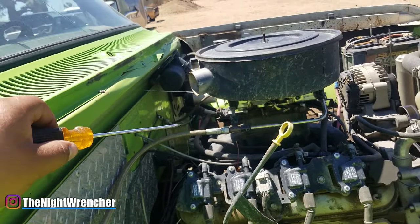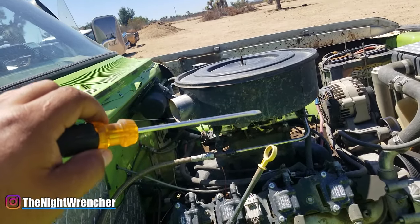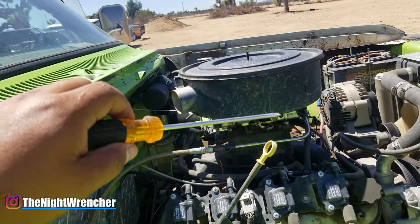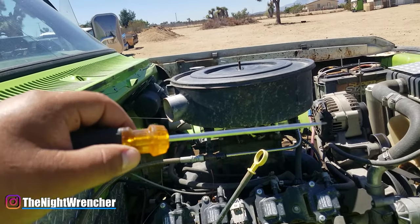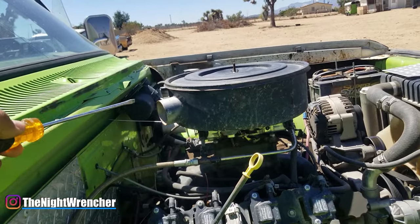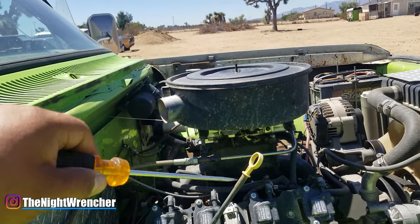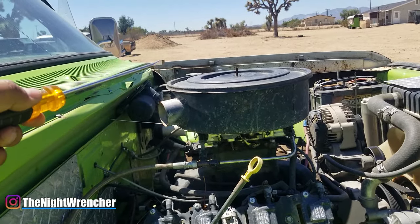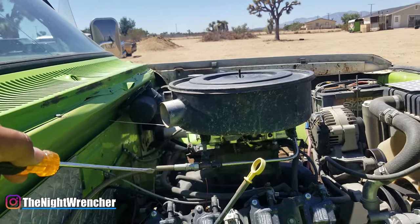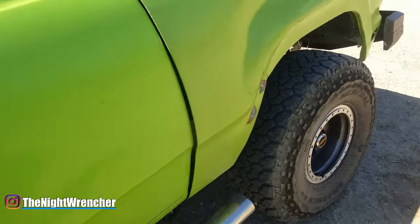When you're running rich out on the road, you're going to tell that you're driving pretty clean and normal, and you go to accelerate and you're noticing that you're losing power, but the engine's not acting weird. What happens when you're running rich is you're adding more fuel than the spark plug can ignite. It's like you're putting water on the flame because liquid fuel can't really light anything on fire. So you end up putting out the spark and you start losing power, and you start losing fuel economy. But overall it tends to run good because it's not running lean — you're not hurting the engine except for maybe washing off the cylinders. If you're smoking like right now, as the engine's warming up, you guys should be able to tell this is not good for the motor.